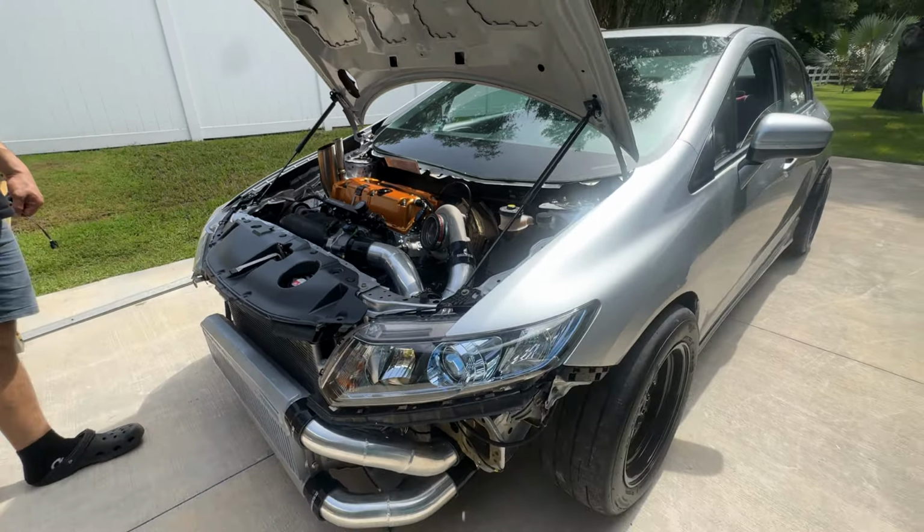The ECU still works in the stock location. It'll sit here. Besides that, I think everything's fine. It's pretty simple. Overall, it's really your choice to do the 2.5. I would suggest if you're doing under 700, do the 2.5. If you're doing over 700, do the 3-inch piping, just from what I have learned and experienced over the years.